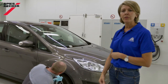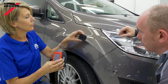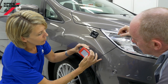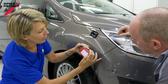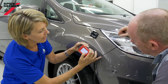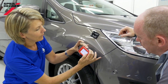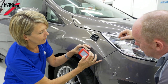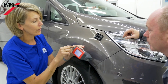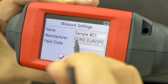To be sure you get rid of the polish residue you must clean after polishing. Doing the measurement is very easy. The only thing I have to do is click on the measurement button. First we are reading the color measurement, after that we have the effect measurement. I have to lift up and move very slightly between the three necessary measurements. When the measurement is done you get a green indication that it was okay. Now I'm going to put in the manufacturer and paint code.